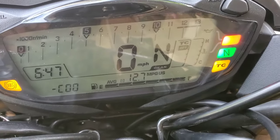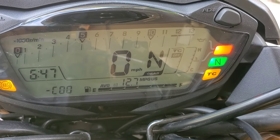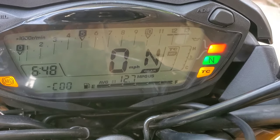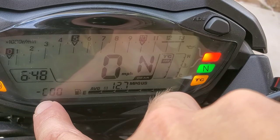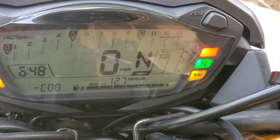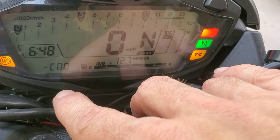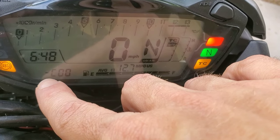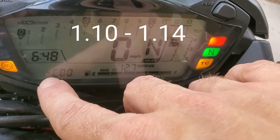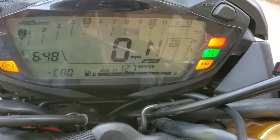To my surprise, when I put the bike in dealer mode I realized it was already being calibrated — which is why you have the line in the middle. If the voltage reading is low, the line will be at the bottom of the C; if the voltage reading is higher, between 11.1 and 11.4, the line will be showing closer to the top of the C.